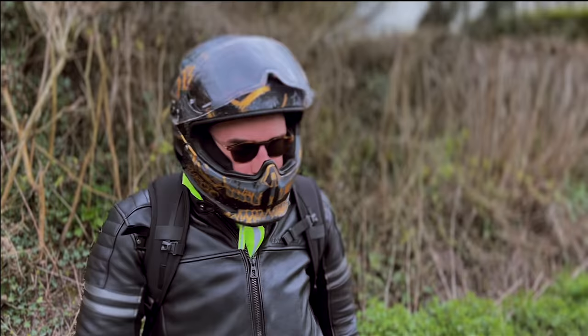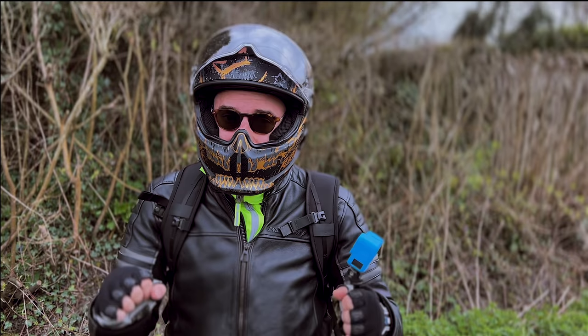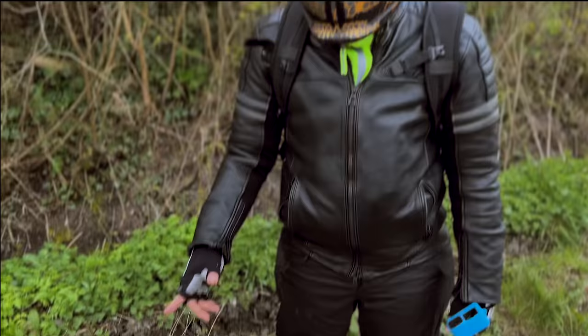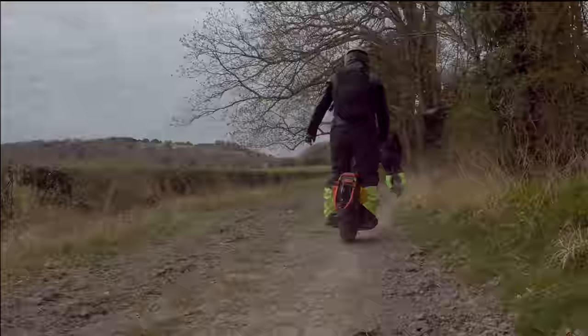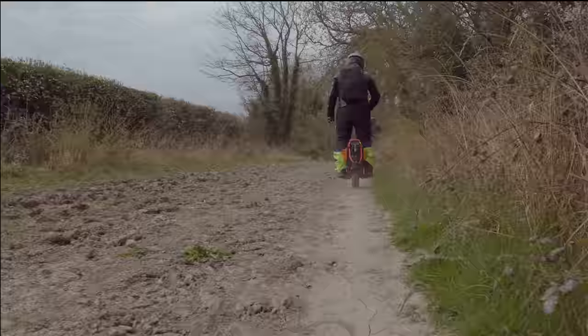First reactions: these small changes made this wheel feel so much better. All the holes seem like nothing — it just flies. Now I have no problems accelerating, and even braking — not fantastic but so much better — because now with the lower center of gravity I can kick a little bit to the side. It's easier to slightly curve, something that was not possible in the original configuration. The tire was no longer slippery when curving, and I had much more control. It was suddenly a completely different wheel.